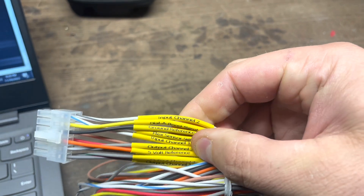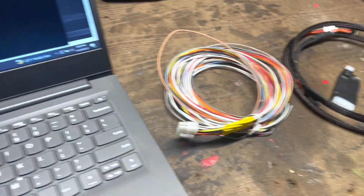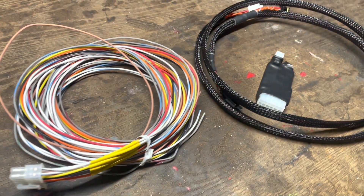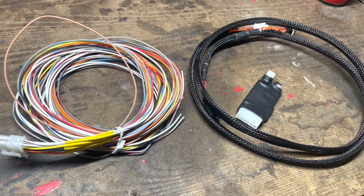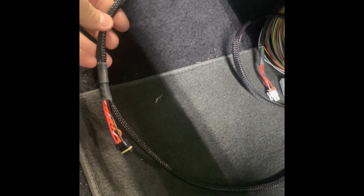In the actual setup you can see there's a channel called flex sensor signal, so that'll be an easy one to test with. Assuming this works, we'll get the channel freed up off the J1 connector and move to a CAN signal. One requirement to use this is to have version V2 firmware on your Holley ECU — I have videos on walking through how to do that. If you have an older unit this is probably something you'll need to do; if it's a newer one, verify before you start. First thing you need to do is wire it in. I bought the power harness when I ordered the kit, which gives you an inline splice to your CAN connector.